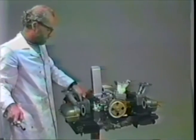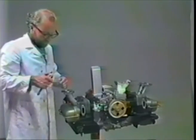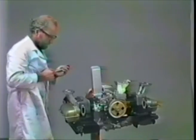If you use 14mm across the flat nuts here, they tend to interfere with the spark plugs. And again, 14mm across the flat nuts are getting quite hard to find and should not be used in areas where you really don't see them. You should save them for the case perimeter bolts. So torque the nut down till it's snug. Change sockets to the 13. Torque the 13 down alternately. Watch the oil cooler, don't hit it with a wrench. You don't want to have any operator-induced faults like Chernobyl.